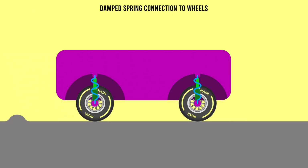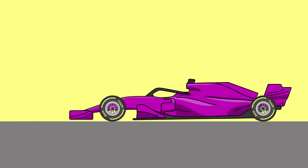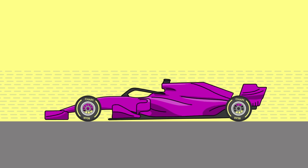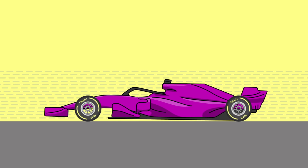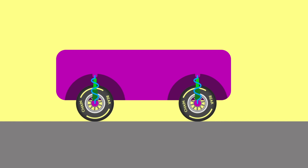So now the ride of the car is smoothed out, and this is especially important in a racing car for both handling and aero stabilisation. As the chassis and its components are fine-tuned aero surfaces, having the car move around in the airstream in a bouncy, chaotic way would undo a lot of the good work put into its aerodynamic design. So keeping the platform of the car as stable as possible maximises its aerodynamic efficiency.